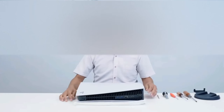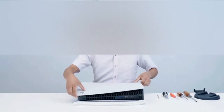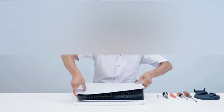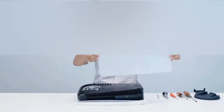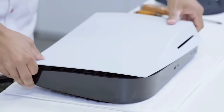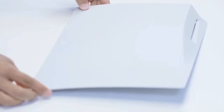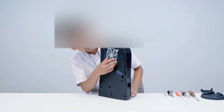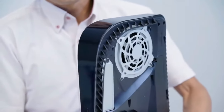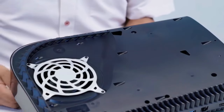This is a detailed teardown of the PS5. This is how you take off the top cover: hold the two edges, press down gently and lift it up, just like you can see in the video. That's how you take it off — gently, you don't have to use a lot of force. Then you flip it over to the other side, same thing with the two diagonal edges, and you can see the fan. It's actually a massive fan, and so is the heat sink — we'll get to that in a minute. This is what it looks like once you take off the cover.